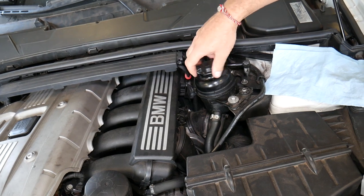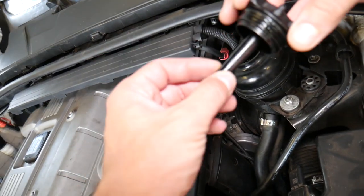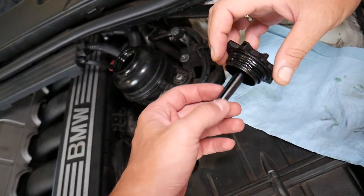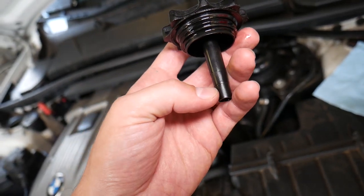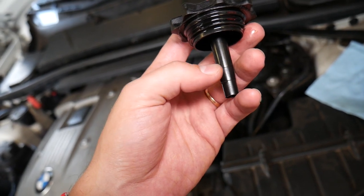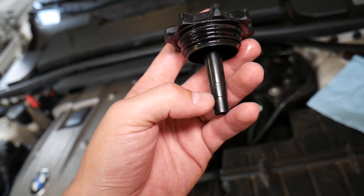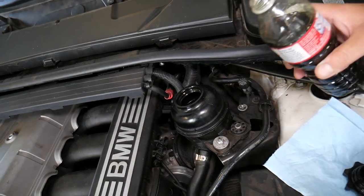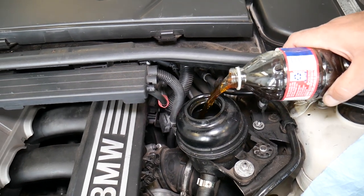You need to remove the cap of your power steering pump. You have two lines — consult your manual, one is for hot and one is for cold. Sometimes one is minimum and one is maximum; it really depends on the design. In most cases it will be between minimum and maximum, or the lower mark is when the power steering fluid is cold and the other is when it warms up. Go ahead and start adding fluid — and never start your car yet.